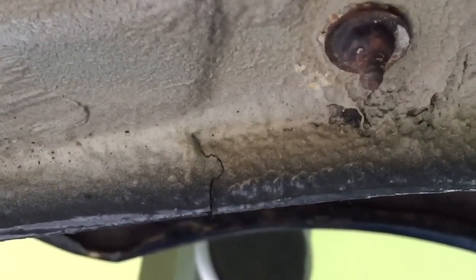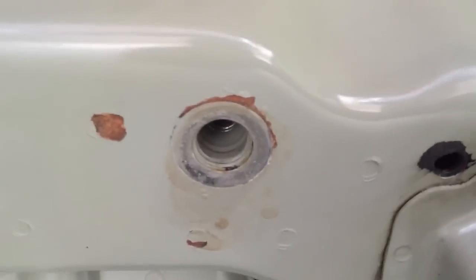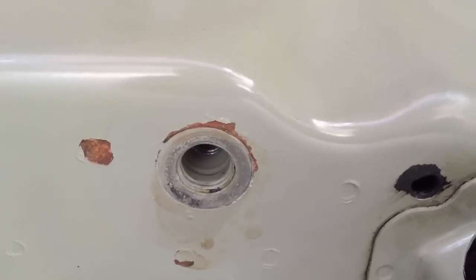And before in the video, that was a definite, that failure there, and so was that crack there. Yet that spot weld wasn't visible because of the dirt, and now look, with the dirt gone, it's clear that the spot weld is cracked and the panel separated. And the same with a bit more confirmation on this rear chassis leg that there's something going on, these two here. So that's the panel degreased.